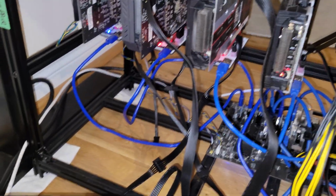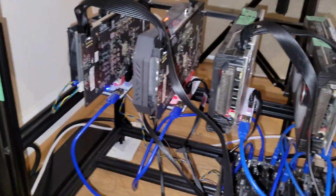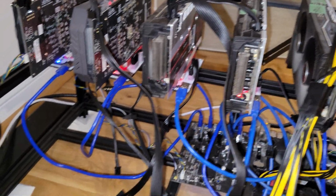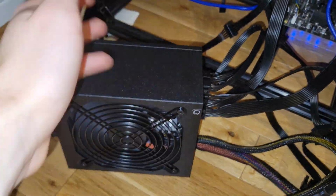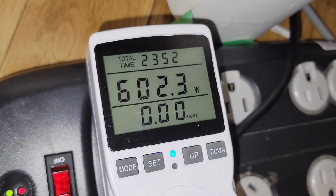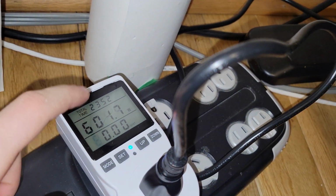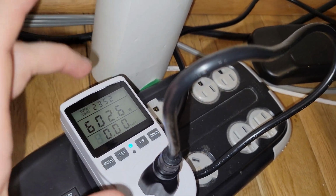In terms of results, the previous PSU was that HP 1200 watt. You can find the video on our channel where we replaced the previous ATX power supply with the server PSU, and now I'm obviously testing another ATX. But anyways, the wattage draw here is about 603 watts. Before I did the switch, we were pulling around 572. So there's about a 30 watt difference.